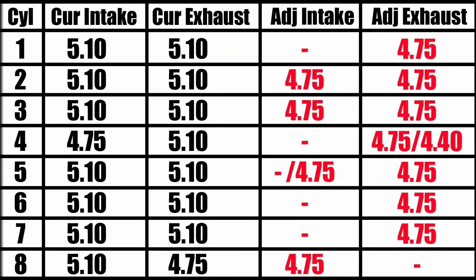The parts are here now, and here we are with the rocker arms. This is where we left off in the last videos when we went ahead and measured the compensating element, or valve lash, whatever you want to call it. We measured everything and found out that I needed to have some thrust washers. So I purchased the thrust washers, they came in the other day, and here we are — let's get them installed. Like I said in my previous video, we measured the compensating element height to see what thrust washers we needed.